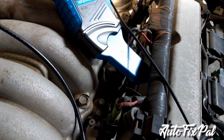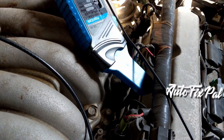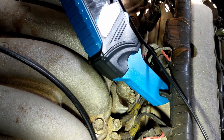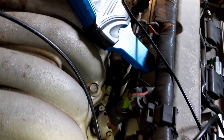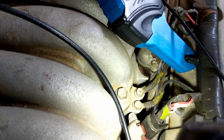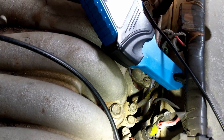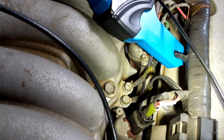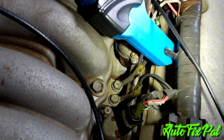The common ground wire for Nissan's ignition coils is usually on the intake manifold on the timing cover somewhere right around this area — wait till the video shows it. Usually around that area or on top of the valve cover on the 4-cylinders, but it's pretty easy to get to, so that's why I hook up the amp clamp to the ground wire so we can get a parade pattern on the scope.